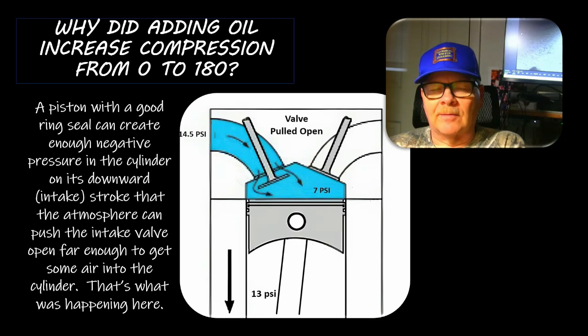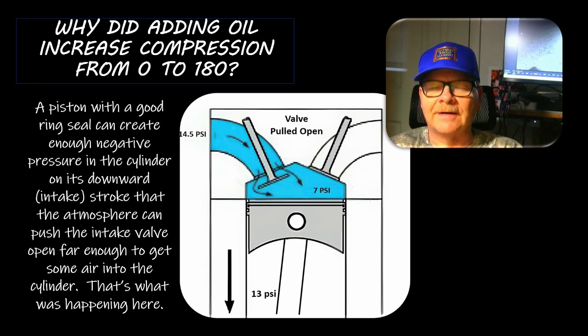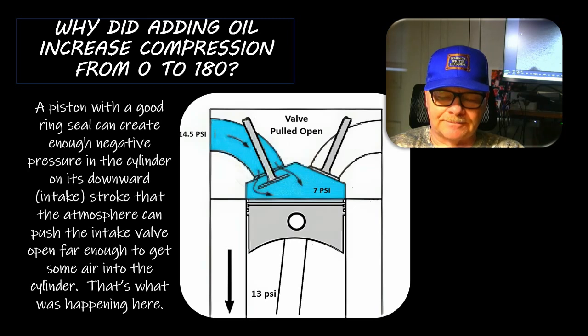Remember that Honda where Richard Sheffield came over with his Snap-on counselor, hooked up a vacuum waveform, and the engine was smoking a little bit. He looked at the vacuum waveform and said this engine is one tooth off on the cam timing, because compression was also higher than it should have been. He was teaching a compression class that night. The next day I had the students pull it down - sure enough, one tooth off, closing the intake valve early.